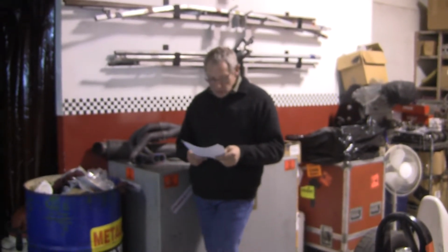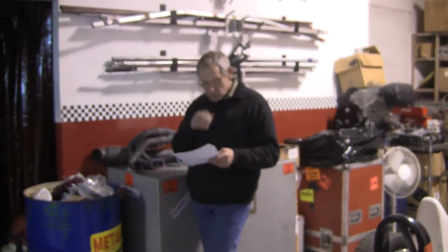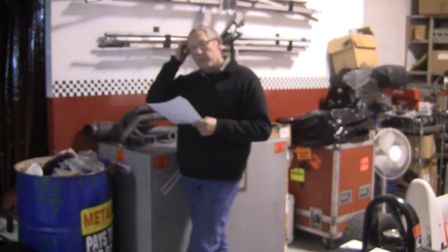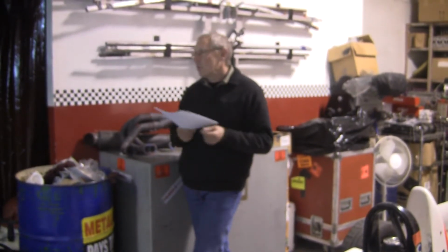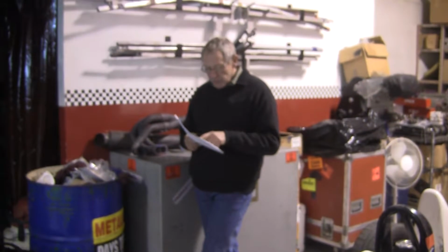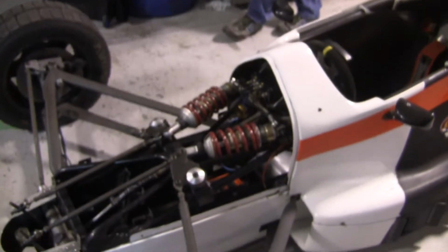Yeah. Okay. So we've spoken briefly about springs earlier. It's important to make sure that you've checked them to make sure that they are actually pairs, and don't necessarily trust the markings. I mean, have them tested, put them on the car, see if you're happy with the way they function. But it's not a very difficult or expensive job to have them tested either. And once you've done it at the beginning of the year, you can put that out of your mind and you know that that's sorted. The droop we've talked about, that's adjusted by the platform height in the shock absorber, front and rear.